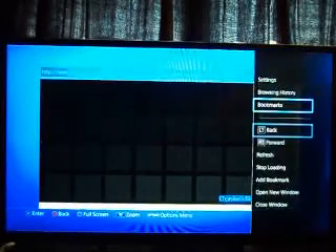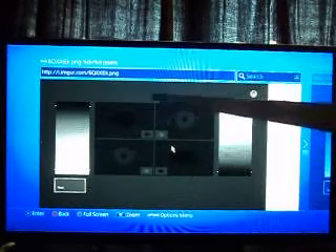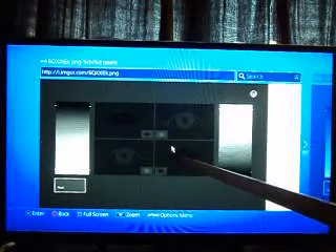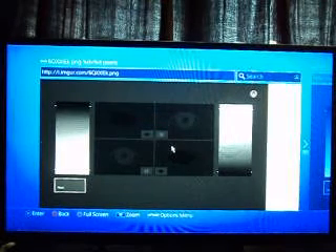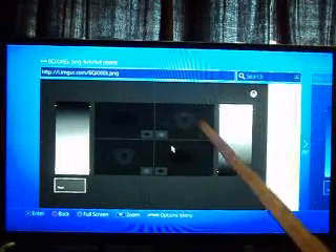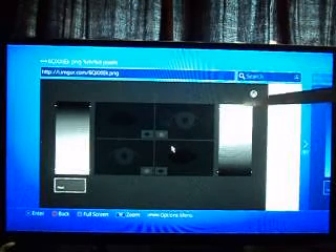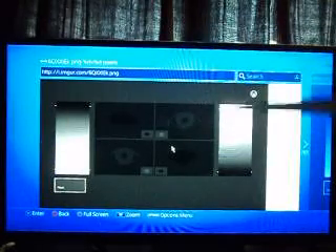Next up is going to be our brightness. I'm going to use the limited range user's example — that's these four squares right here in the middle. You're going to see a closed eye on the top left and then an open eye, and then vice versa down here, with the bottom right being a closed eye. You want to adjust your brightness down to where this closed eye just disappears into the background it's in. Right when it disappears, stop adjusting your brightness — you should still be able to see this open eye to the right. For full range users, do not use this middle example.